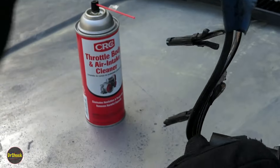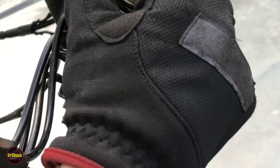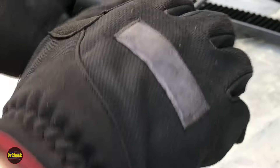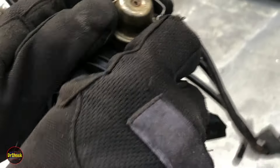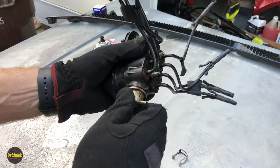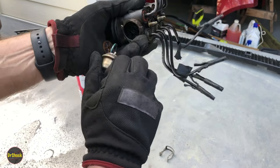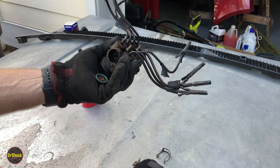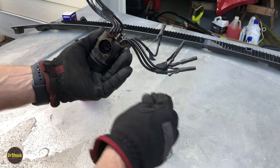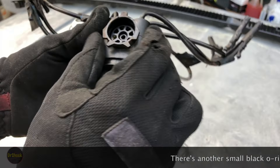This is the fuel regulator — it's held in by a little retainer on the end that just folds out. Once you get the retainer off, this guy just comes out. You've got the regulator body, an O-ring, and a filter, and we'll replace all of those. Removing the regulator lets us get in and clean where we couldn't clean before — there's some carbon buildup behind the bracket that we couldn't access. Now we can get in here with a wire brush on both sides.